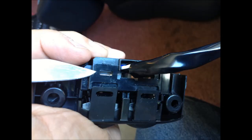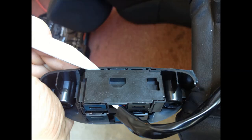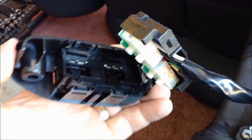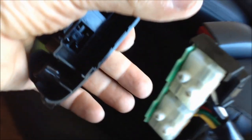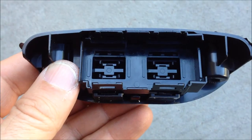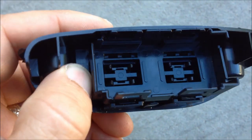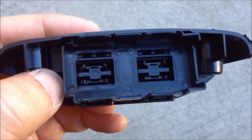With the switch bank removed, you have to carefully pry these clips up — there's two on the top and two on the side. Once those are released, the whole switch assembly comes apart. Here's a picture of the circuit board that holds the switches. You can see the inside of the switch assembly: these are the actual switches, and then there's a back plate that holds all the wires in place. Inspect this part of the switch to make sure the little tabs on the rocker are still in place — this one has them in place, so this assembly is good.